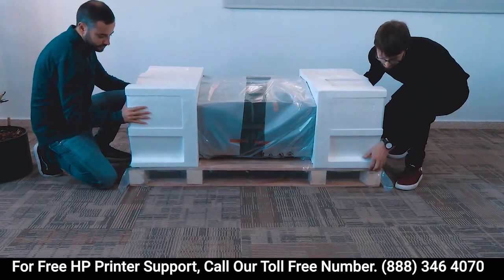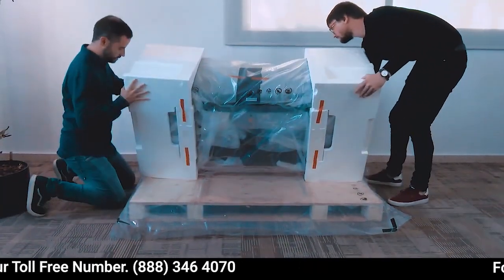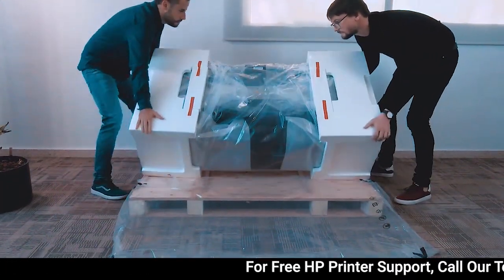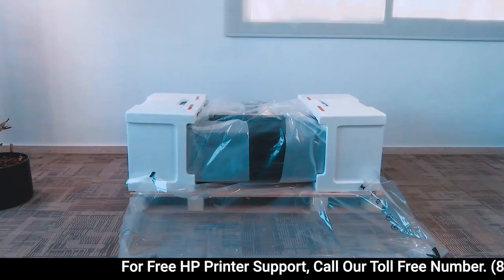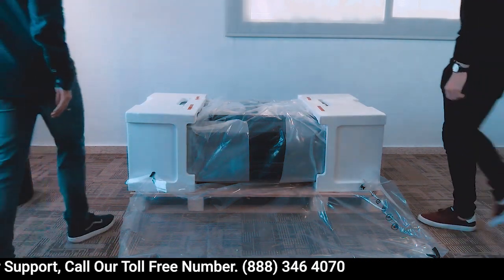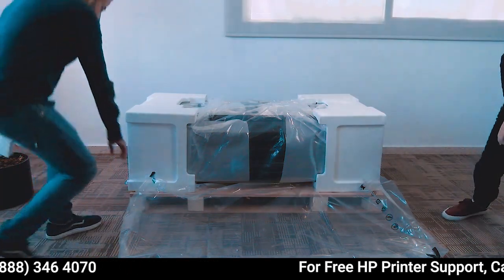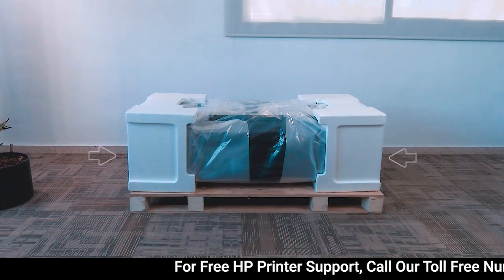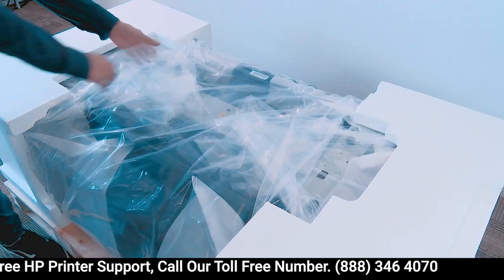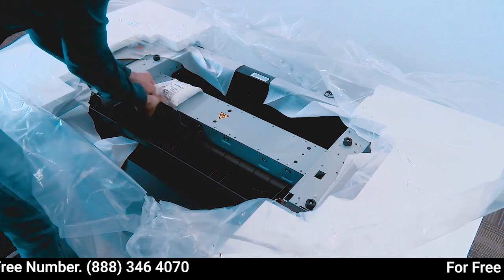Make sure there is nothing on top of the printer body before continuing. In order to attach the stand assembly, carefully turn the printer 180 degrees so the bottom is facing upwards — you may need a third person. Remove all the tapes from the film, then remove the tray and box. HP recommends having two people unpack it. Remove the plastics and small flaps. Do not remove the foam end pieces. Remove the tape from the transparent covering that protects the product and open it. Remove the desiccant bag from the top of the product.